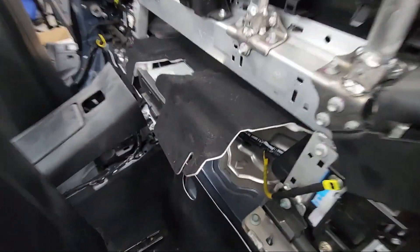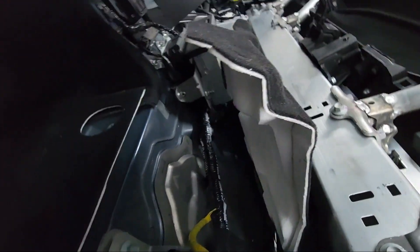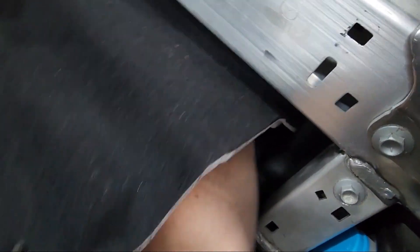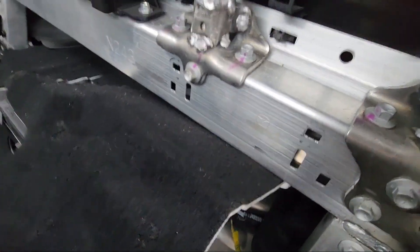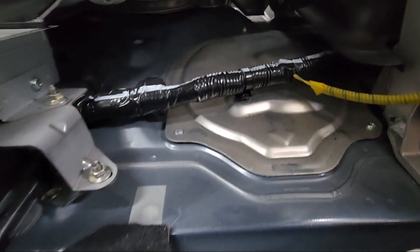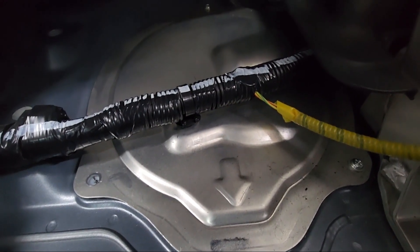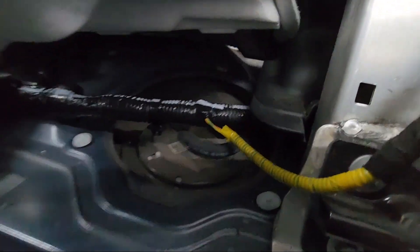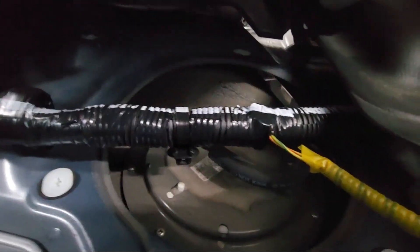Once the carpet is unclipped, you can see it will lift in front — it has styrofoam insulation on the bottom. Slide your hand all the way to the back and lift up, and it will unclick. You'll then be able to see the entire fuel pump cover lid with several Phillips screws. Once you've removed the three Phillips screws holding the cover down, slide it past the wire harness and set it in the base of the car. You now have access to the fuel pump lid and fuel pump basket assembly.